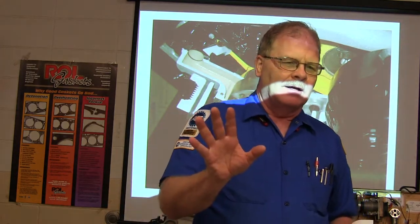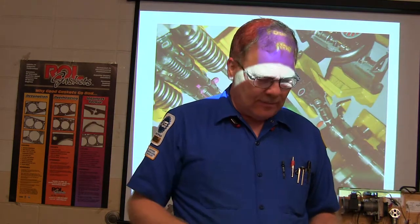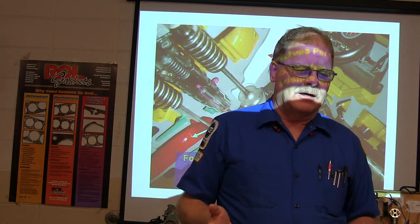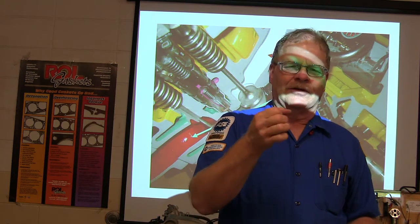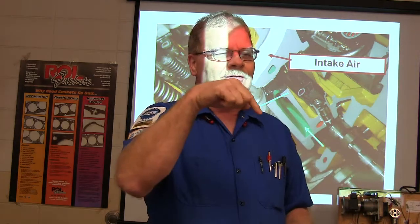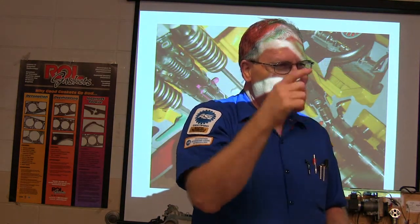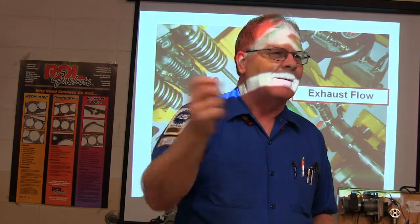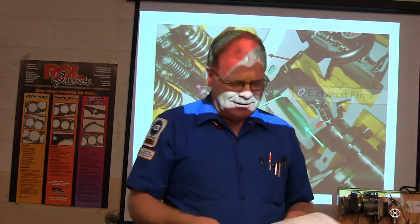And you'll see them, you can tell if some people put them back on there, but you pull them off and leave them off. Like on some of the Ford transmissions, when you pull the transmission oil pan off the first time it was serviced, there was a little old plug with a stem on it and an O-ring around it, rolling around in the pan. That's because it was in the transmission until they got ready to put the dipstick in, and when they put the dipstick in, they shoved it on in and just let it roll around in the pan. Well, some mechanics that didn't know what that was would put it back in there because they thought it needed to be in the pan. Just something you leave off.